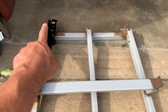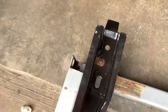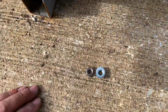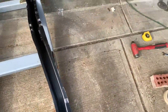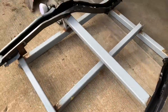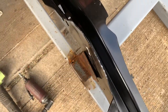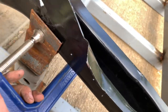I'll put the bolt in the front here, get the little strap put through, and do the same thing to the passenger side. I've got the fronts all bolting — you can see the bolt sticking through in the cage nut. Come back here to the back: I made these little straps that basically slide through the spring shackle hole and put the hardware on it. Lines up with those two ears there. Put the nuts on, snug those down, do the same to that side. I've got all four points mounted. The other reference points are the little side saddles, about right above where the axle would come in. The weld is super close — I can't even get my fingernail between them on that side.